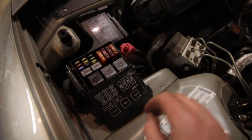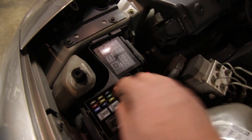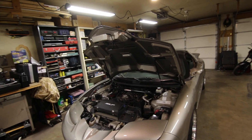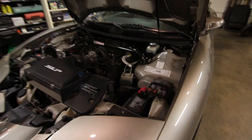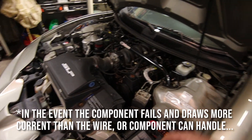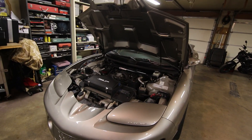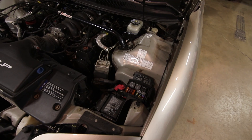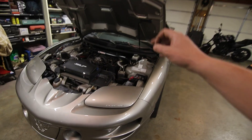Here's something I noticed: the cooling fan actually has an oversized fuse — a 15-amp where it should be a 10. Quick tech tip: you do not want to oversize the fuses protecting a circuit. If something is designed for a 10-amp fuse and you put a 20 in it, you might overload a component and it could start a fire. If you have to oversize a fuse, you have a component issue. Don't oversize your fuses, especially when they're spec'd by the manufacturer.